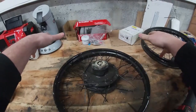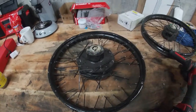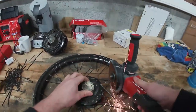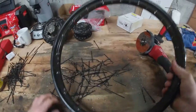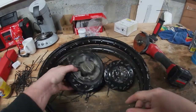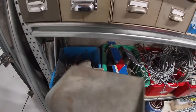I just went ahead and cut them all with the angle grinder. I'm not going to bother removing each one if I'm going to replace them anyway — it just takes way too long. I'll cut the other one too so I have both rims apart. There we go — two rims and two hubs completely free of spokes. If you're going to try this yourself, please be careful because some of these are under tension and will snap. I already cut my hand, so maybe wear gloves.